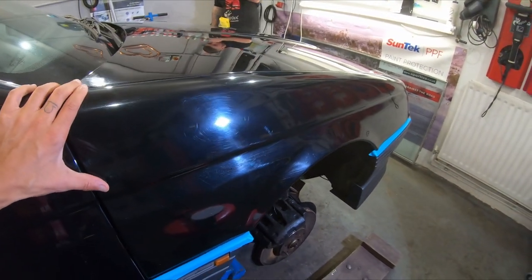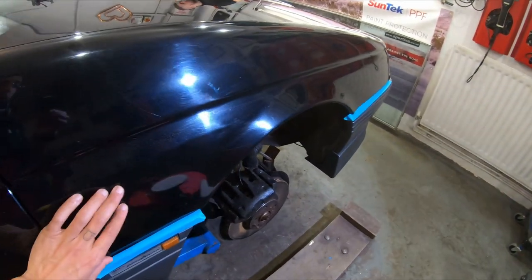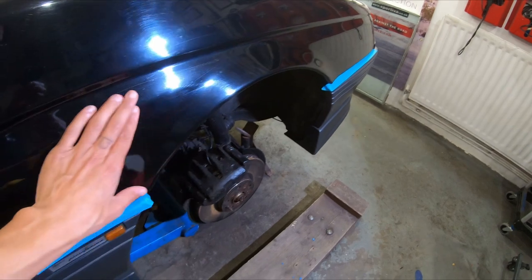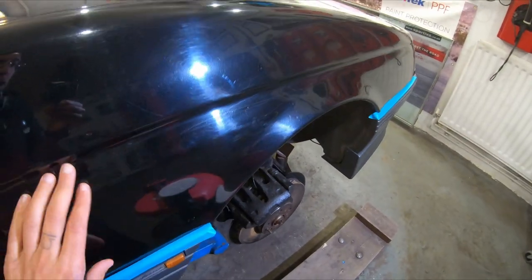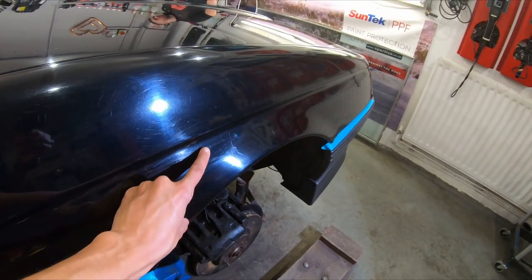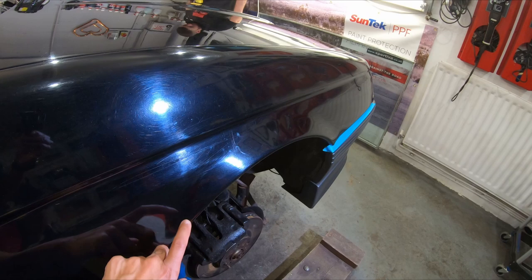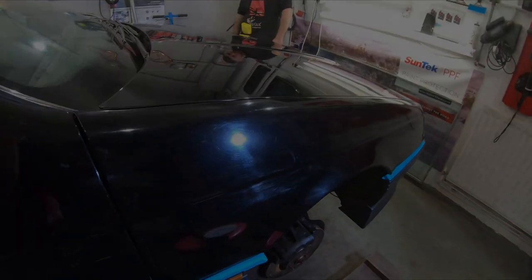So wing is tricky. I think I'm gonna hit this top swage as one, and then I'm actually gonna do half this section, but there is something on this paint. I can see it already. I'm gonna do half this section, half over there, really being careful on these points here. I don't want it bridging and burning here or up here. So really slow, careful work.